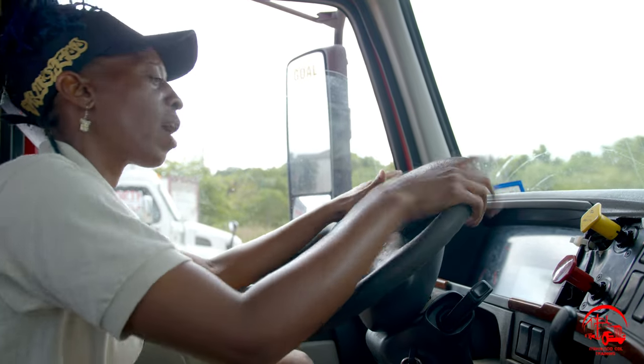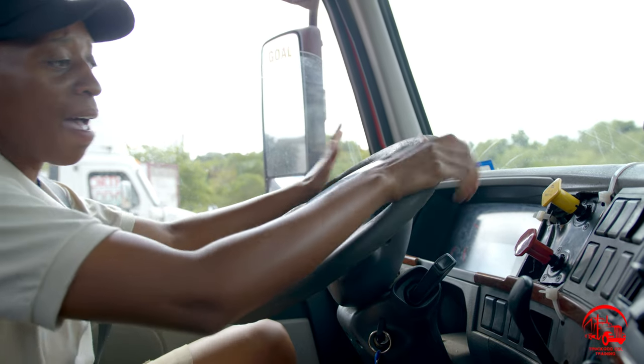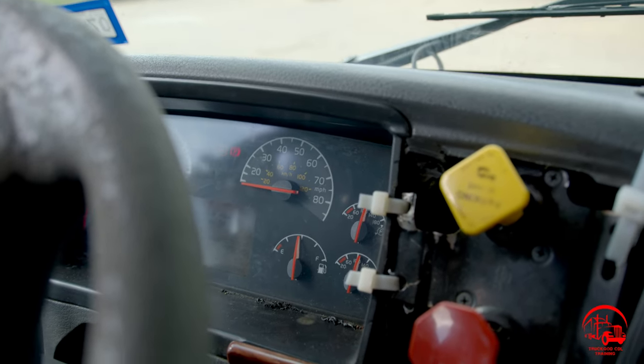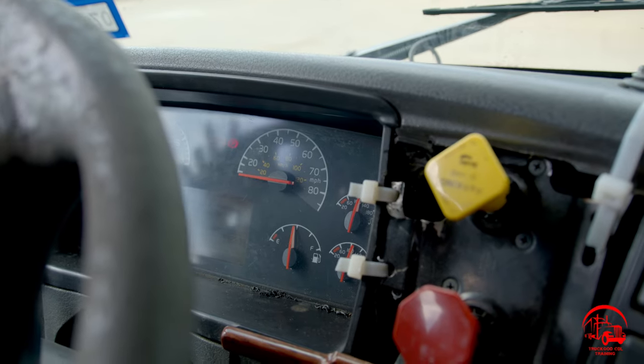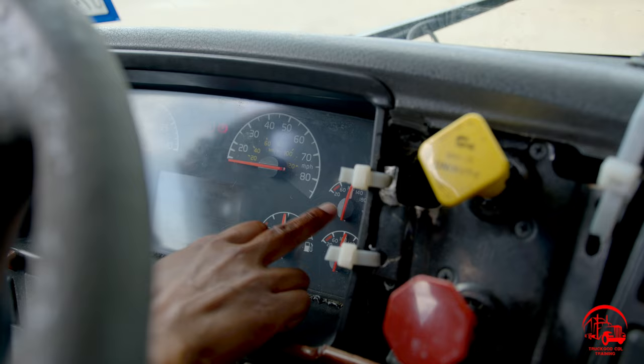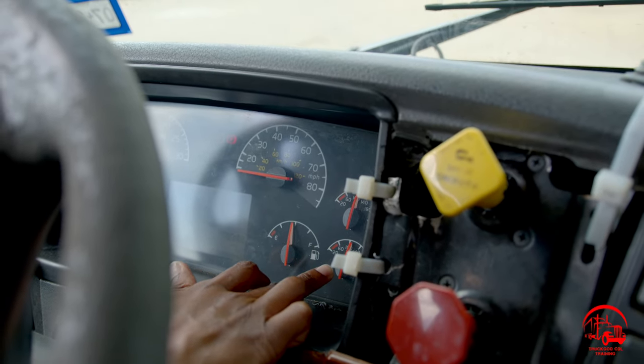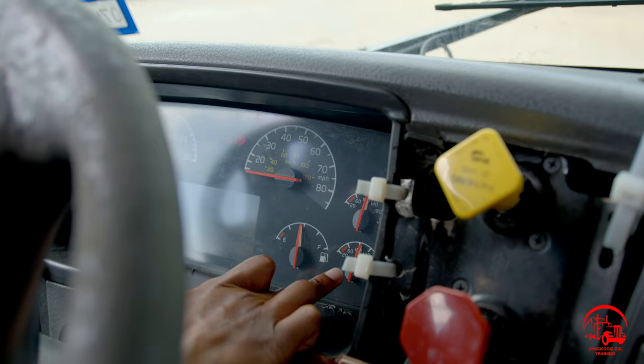All my gauges are properly mounted and secure, not bent, broken, or cracked. All nuts and bolts are present and tight. All right, so the book has it listed in a specific order, but me personally, I like to go from right to left when talking about my gauges. So first I have my primary and my secondary air tank gauge reading between 125 and 135 PSI, working properly.